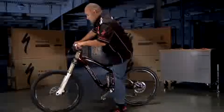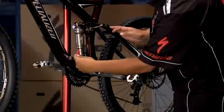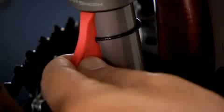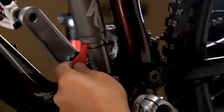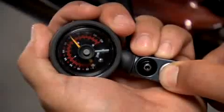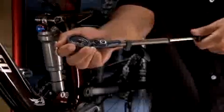After rolling 9 to 15 feet, carefully dismount the bike. Look at your shock and use the sagometer included with your Enduro to measure the distance between the shock dust wiper and travel indicator o-ring. Your sag is set properly if the o-ring falls within the groove of the sagometer as shown. If the o-ring is above the groove on the sagometer, you have too much air pressure in your shock for your weight — remedy this by decreasing air pressure in the shock with the pump. If the o-ring falls below the groove in the sagometer, you have too little air pressure — remedy this by adding air pressure with the pump.